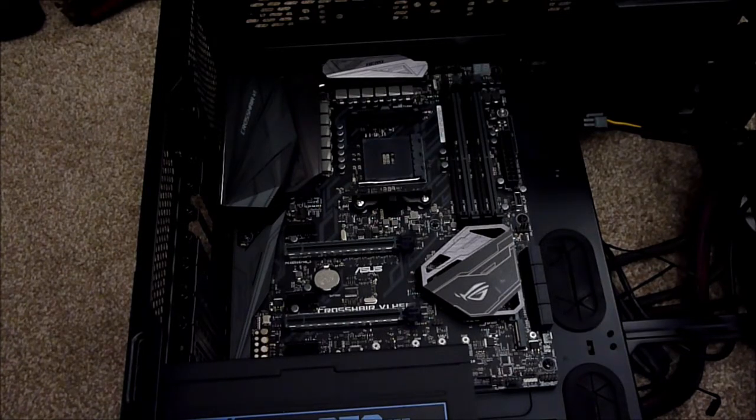With just a little bit of pressure I managed to get all the screws in. So what I'm going to do next is get the two heat sink retaining clips off, because I've got to put the AM4 retaining screws in for the Kraken, and then we'll go from there.